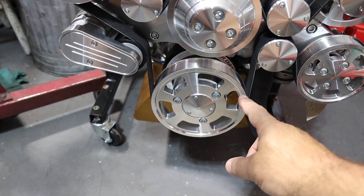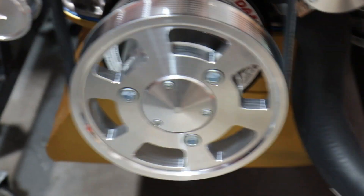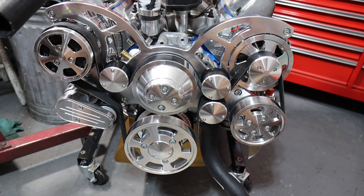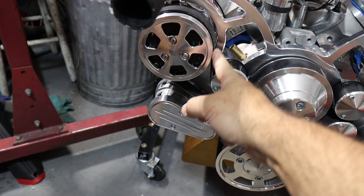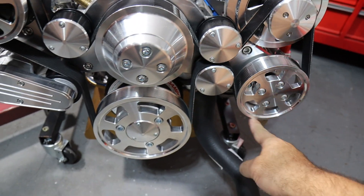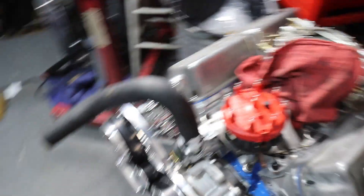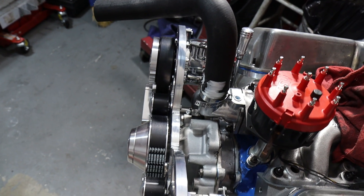There's an adapter behind the crank pulley. The harmonic balancer is pretty far back, and there's a spacer that puts the crank pulley further out so it's in line with the rest of the accessories. The belt goes around the AC compressor, around the idler, over the water pump, around another idler, around the alternator, around the power steering pump, around the third idler, around the crank, and back to the idler. It is a single 8-rib belt — nice and wide and plenty strong. Most stock belts are 6-rib.